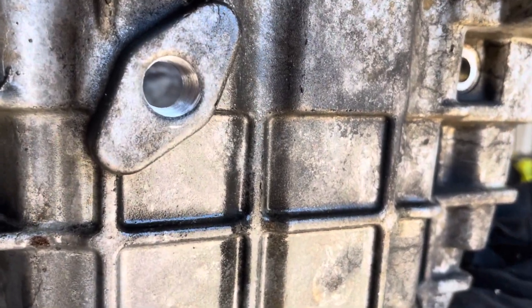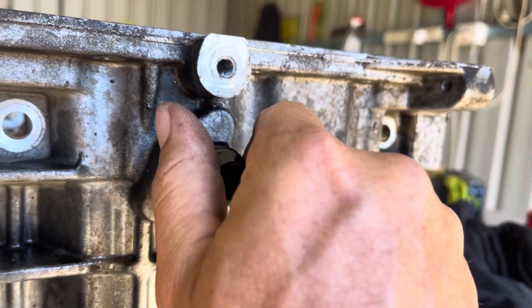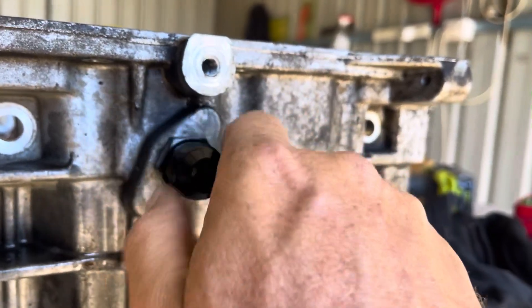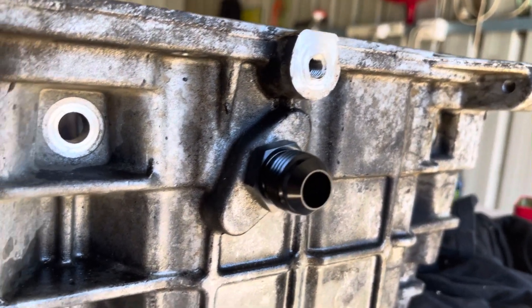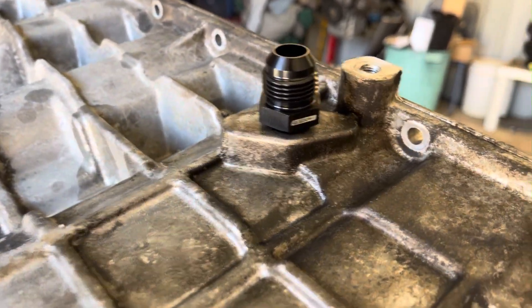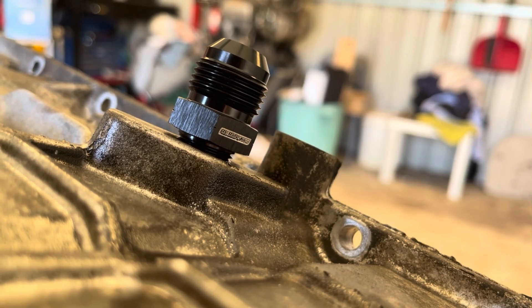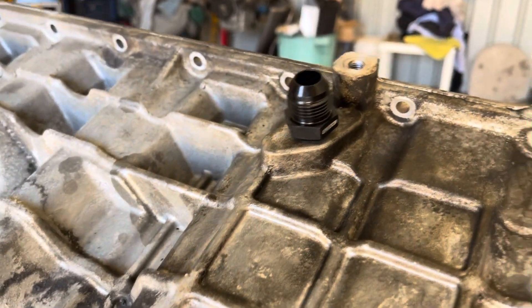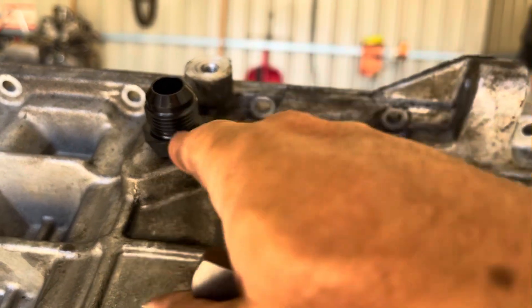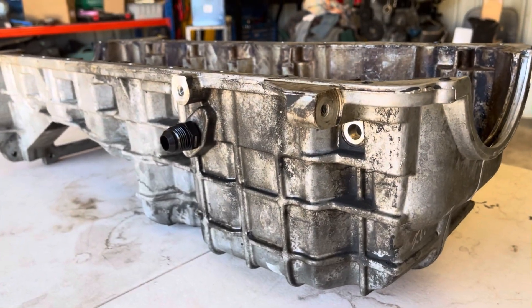Giving that a nice cleanup - looks bloody beautiful. Now let's see if this fitting is going to go in. It should - there's no reason why it won't. Like butter! That's a tapered fit so it should get tight. Beautiful - there we go, all done. That's actually turned out really well - I'm pretty stoked with that. There's a little bit of thread sticking out underneath but if I crank on that with a spanner it'll seal that up even more. If you're really fussy you could tap it in a little bit deeper. I might even put some sealant on that, but I'm pretty happy. Now all I need to do is clean up this sump, give it a lick of paint, and that's one piece of the turbo puzzle sorted.